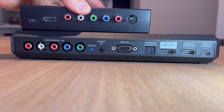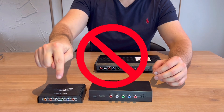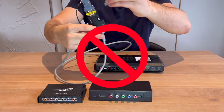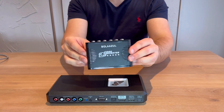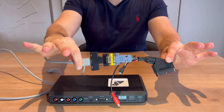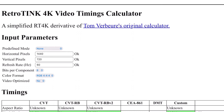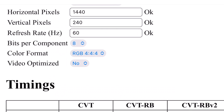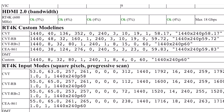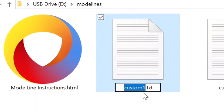The RetroTINK 4K has the same analog inputs as its predecessor with the addition of VGA and HDMI inputs, so you shouldn't need a DAC, sync combiner, or transcoder on the input, but you will need one on the output — either using a 240p-compliant HDMI to component converter or an HDMI to VGA DAC with a sync combiner. To output 240p, you'll need a custom mode line formulated with Guzbaz's RetroTINK 4K video timings calculator. Add the horizontal and vertical output at your desired refresh rate, scroll down to the mode lines that are 12 items long, copy one into a text file, name it custom1.txt, and save it to the mode lines folder on the SD card and hope for the best.